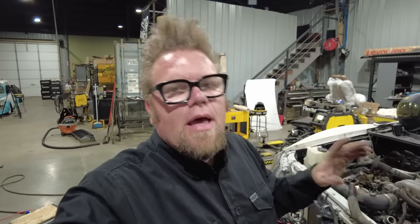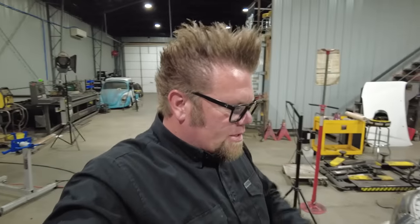And what they'll do is they'll assemble it for me, and then I'll mark the orientation and the clocking of the fittings, and then they'll crimp them. But this one I'm going to mark, and I'll take it out, and then I'll put that big one in, and then those will be ready to go. Then we can do power steering lines for that. Truck's got to go up in there.